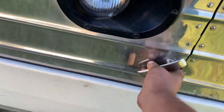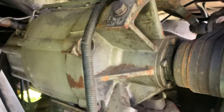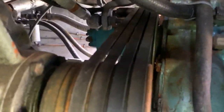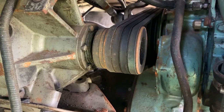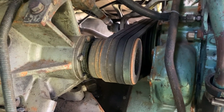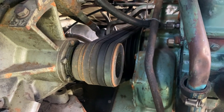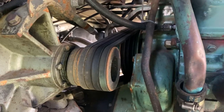And if those weren't enough belts, the MCI also has all these belts on this alternator, which is a 50DN — about 230 amps, 24-volt — with four belts on it. It's a little better to have it belt-driven than gear-driven because gear drives sometimes fail, and when they fail they destroy the gear train and can ruin an engine. The GM engines are known for doing that, so it's probably better it has this, though I don't particularly enjoy changing belts on these things.